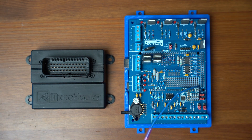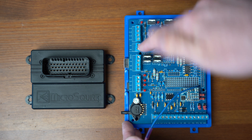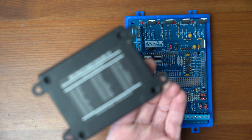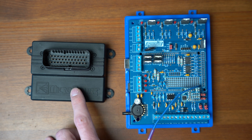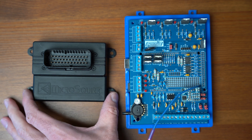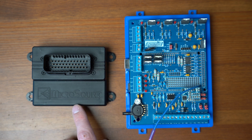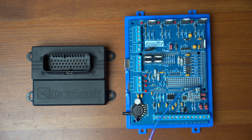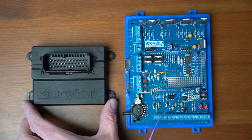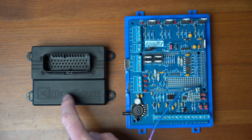Another part of the form factor that is a little bit different is that all of the MAP sensors for the Micro Squirt need to be external. There is no included MAP sensor on the Micro Squirt. A lot of modern ECUs have a MAP sensor built into them, however the Micro Squirt does not. I believe this is because they anticipate running Alpha N on a lot of small engines — this is typically put on a snowmobile or a motorcycle where it has very low vacuum and individual throttle bodies.